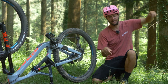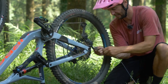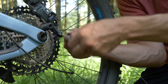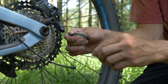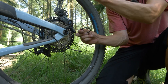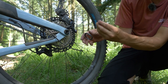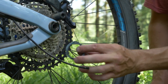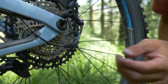With the excess that you've got left, just reel that up down at this end, wrap it around your fingers a few times, really get it going. Coil that up until you've got a bit at the end, and then with this end bit here, just wrap that through a load of times and that is going to keep that coil together nicely. Happy days — that will get you home easy peasy. Look at that for a hack. Fourth gear, uphill, downhill, you can carry on riding all day. You might get a bit of flapping around, but if you can, maybe thread it through somewhere. You can pop the outer in a touch — just holds it nicely in place there as well.